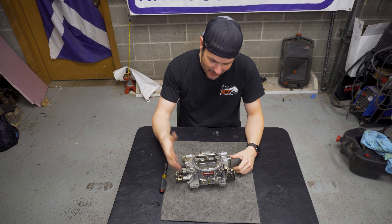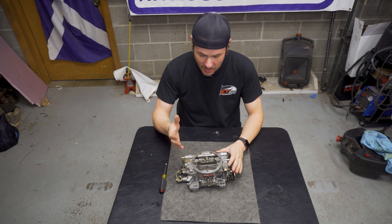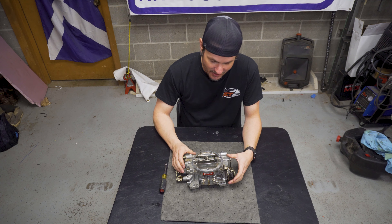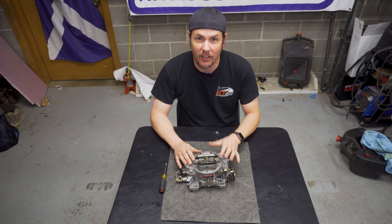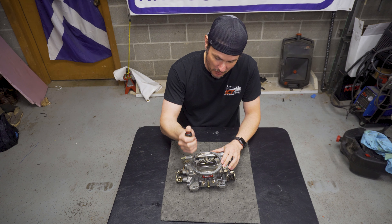Let's dive into the carburetor, take a look at it, and explore some of the different systems on the carburetor that tie back to what we know them as on an EFI system. What we have here is an Edelbrock — they call this a Carter style carburetor because of the setup on it. There are really two big ones out there: the Carters and the Holleys, which are the double pumpers where you have the bowls on the end. We'll focus on the basics here and talk about some of the differences, because the Holleys are going to use metering jets whereas this one uses metering rods.